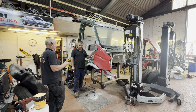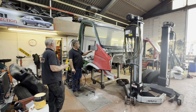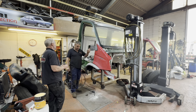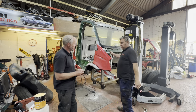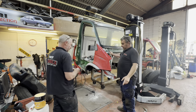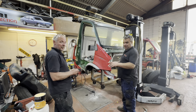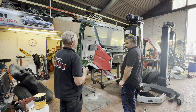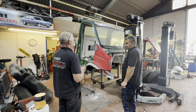Inside obviously, not the glass. We need to paint the inside of the cab — the footwells, the door shuts, under the bonnet, the windscreen panel, and the inner wings. Take the wings off and paint them too. No one's ever going to see it, but it's actually protection — it's protection.